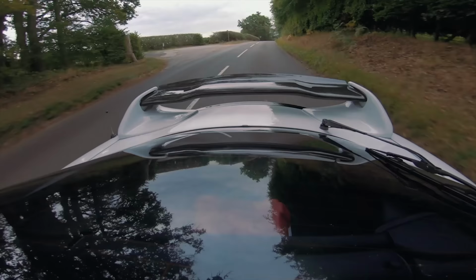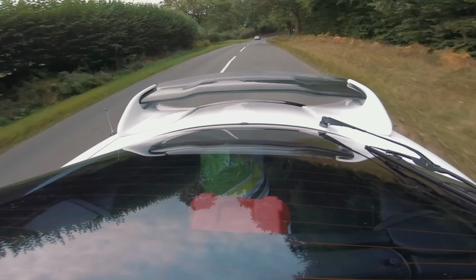That sounds sick. That sounds militant. It's a real precise banter, isn't it? Yeah. But the turbo size is actually quite linear. There's a bit of lag, but the delivery is quite smooth. Very smooth. Being not a massively torquey engine anyway, the power is quite progressive all the way up to the top of the revs. What RPM does it rev to? The mapper JD put a limit of 8,000 on it. 8,000, so these things can rev, can't they? Yeah, definitely. It comes on boost at about 4.5.